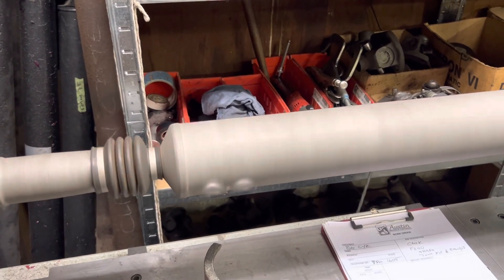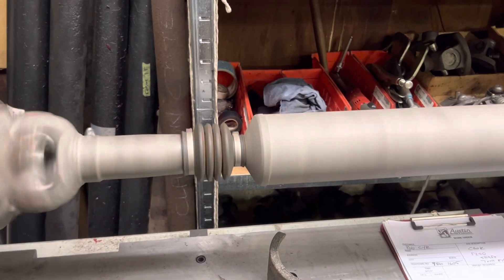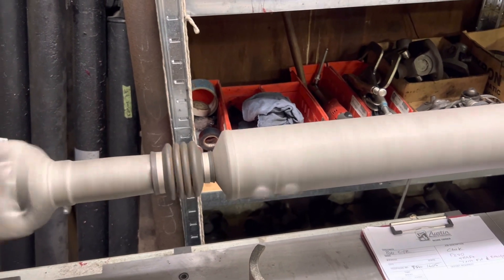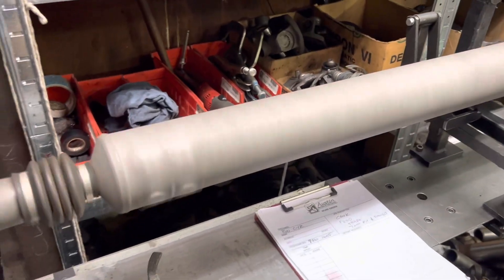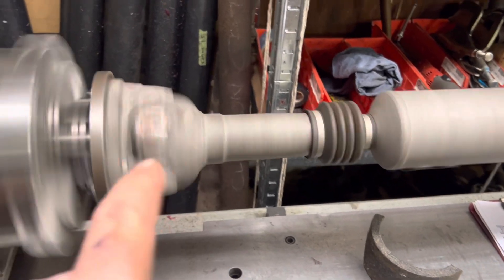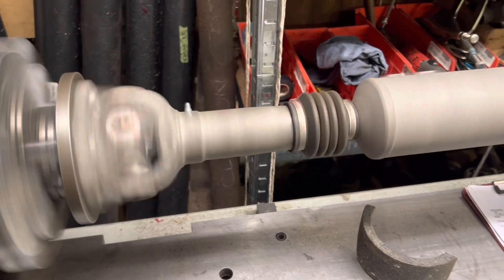This did have a layer of probably POR-15 slathered on it, and I'll be very honest — that's not my favorite thing. Painting over rust, regardless of what they say, is like putting vinyl siding on a rotten house: it does not make things better, it just hides it. So sandblasted down to bare metal. The grease fitting in the slip yoke and the stub slip were in good shape, and I rescued the flange that goes onto the transmission.